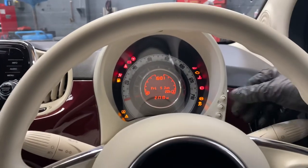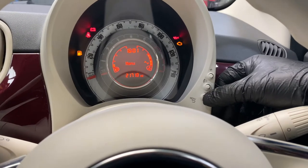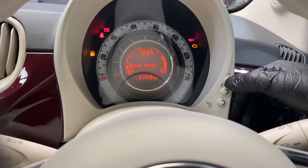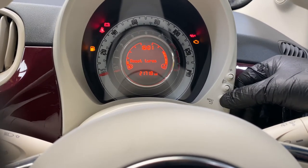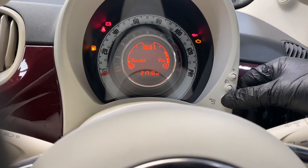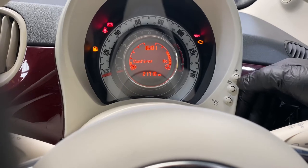As you can see over here, we've got a menu button. Press it — it says menu. Press the plus button and it's going to take us to tire pressure. As you can see, it says 'Reset Tire Pressure.' Press the menu button and it says reset. Press yes.